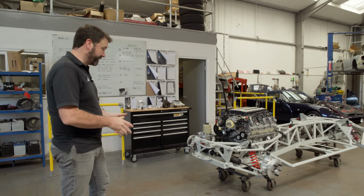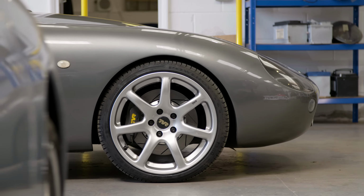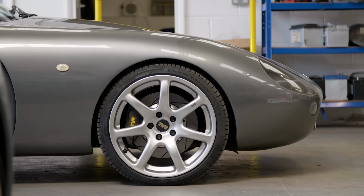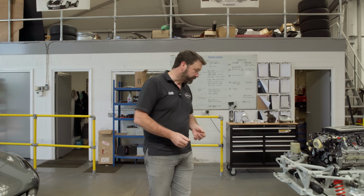So the initial development of the chassis was driven by customers wanting to put bigger wheels on, wanting to fit the spider wheels. And the suspension geometry, the steering geometry on the standard Griff and Chimaera is quite compromised. And putting bigger wheels on actually sort of accentuated the poor steering geometry.